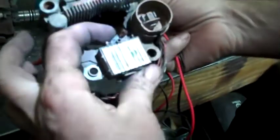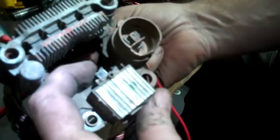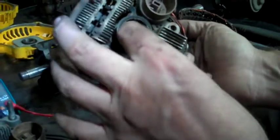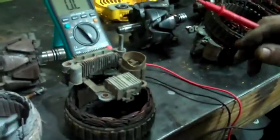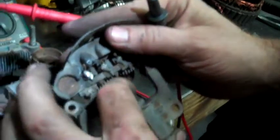These are the brushes. They need to stick up about a half an inch. These look good. These other brushes look really good — they're nice and long, so there should be no problem there. Those are good brushes. These brushes on this one, you can see they're really short — they're worn out. That's why I cut it up to be an example.